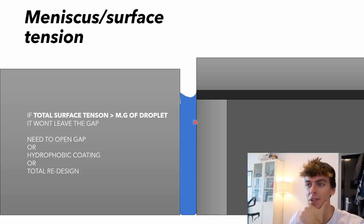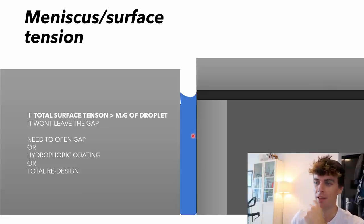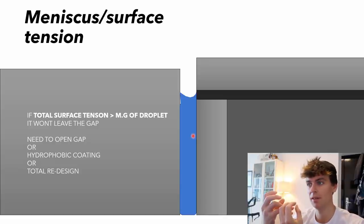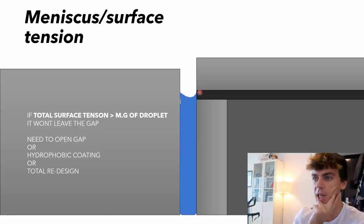And then what does that do? So you get this meniscus forming, and a mixture of air and water, which is particularly bad for corrosion. I mean, most corrosion happens quite violently when you have the electrolyte mixing with the air. There could be some element of anaerobic corrosion, which is corrosion without oxygen, but I don't think that's the likely cause.